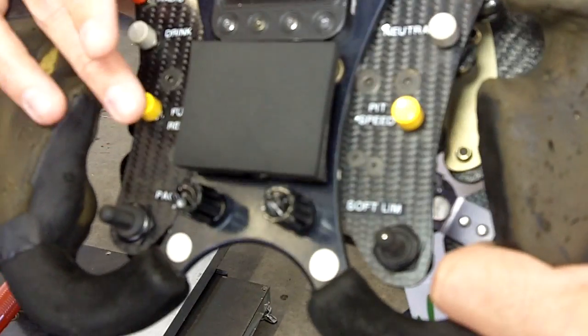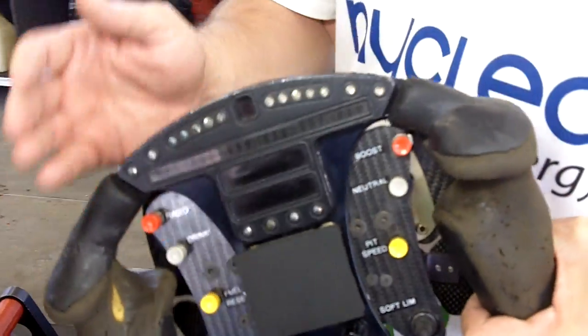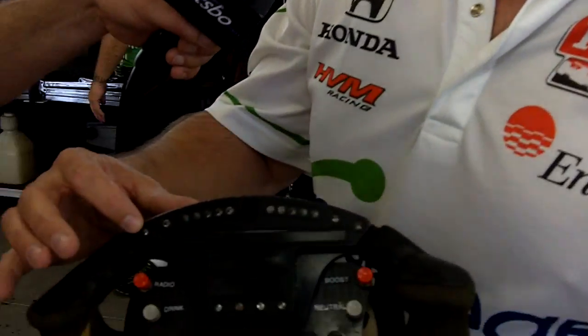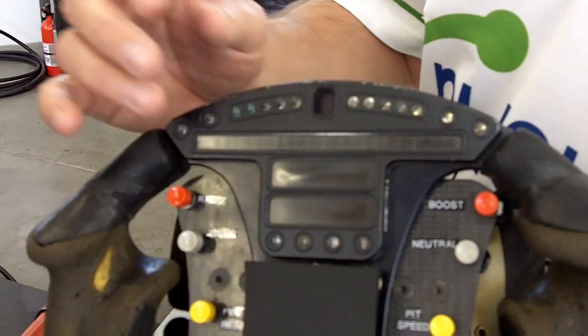When they come in for pit stops, they have to hold this button for 3 seconds and it resets the fuel counter on the dash. She normally sees it up here and it will count down from 22 gallons. Once it gets below a certain number, these indicator lights activate — if it gets below 2 gallons, this light turns green so she knows fuel is getting very low. If the team doesn't call her in within 2 or 3 laps, she needs to come in anyway.